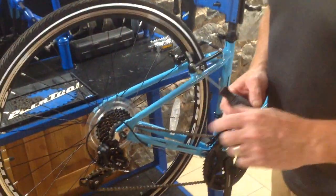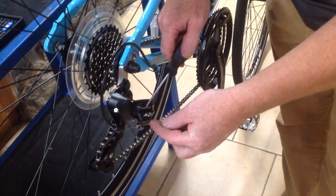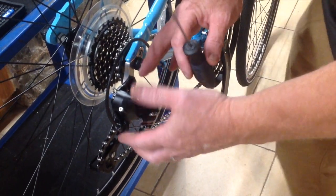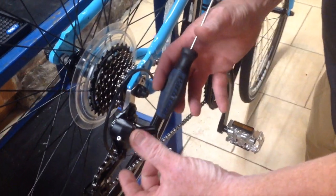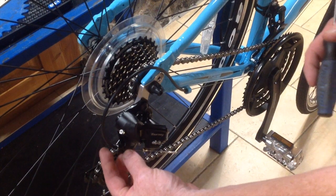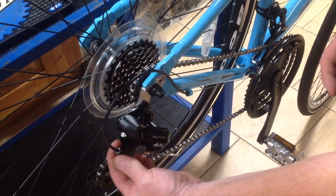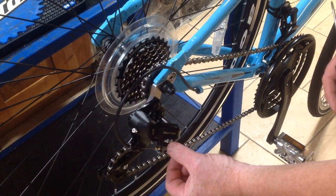Let's continue on with gears. On the derailleur here we have two micro screws which are quite important to understand. That's this screw here and this screw here. So the sole amount of usable adjustable parts on this derailleur system, let's take away the complication. We've already covered this micro adjuster here, which is for the cable, so that's one thing. And then we've got this and this.